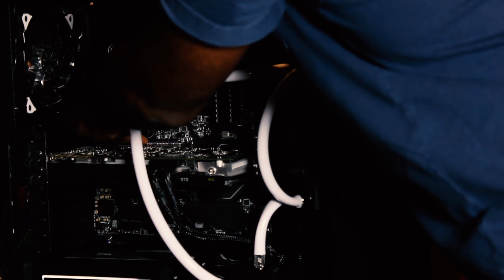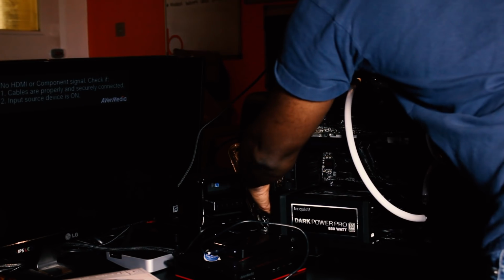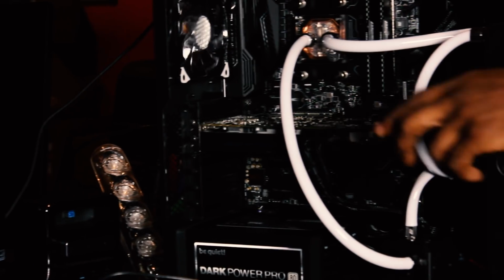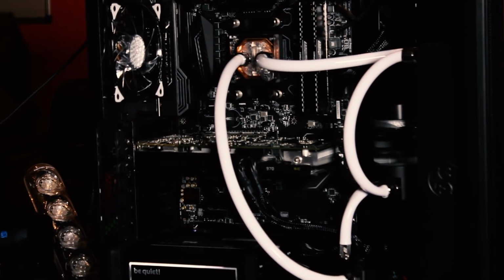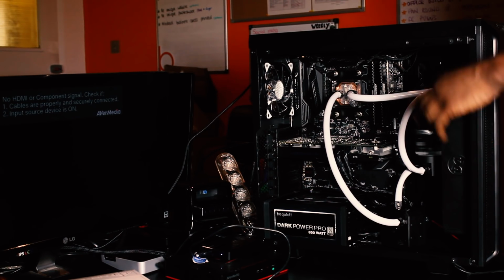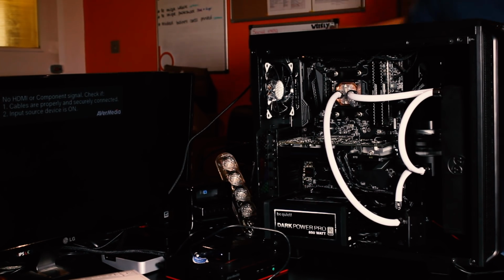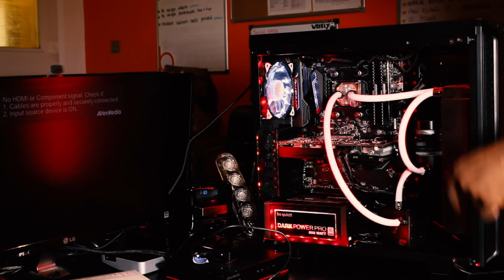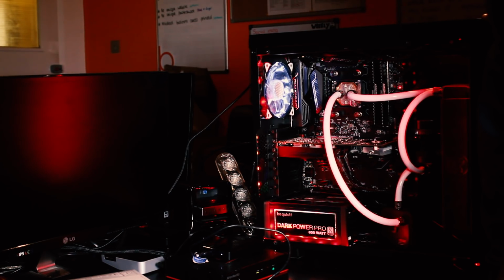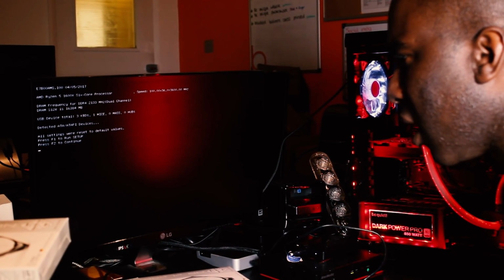So first off, I'm going to take the watch battery out and see if that does anything. Power it on, and that clearly hasn't worked. So what we're going to do now is turn it off, and take out the power lead, leave it off so it cycles all the voltage away from the actual system. So wait 30 seconds. Then we're going to plug in the adapter, turn it on. Hopefully this will work. If not, then I'll just have to do the last phase, which is the jumper. Right, that has worked. So that's one way of getting back into it.